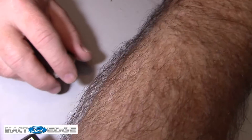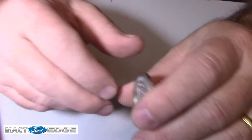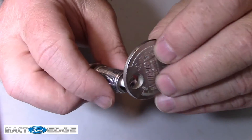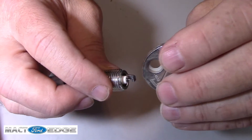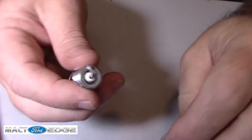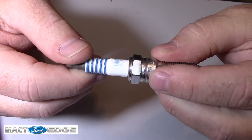Essentially what we've got is four spark plugs at .051 and a couple that are nearly .052. Again, you want to be careful with the gaps — you can adjust them. You can pry it up or knock it back down by pushing on the end, adjusting it using this tool. As far as the gaps go, that's where they're all at for six spark plugs. These are the Motorcrafts — they're platinum plugs. Iridium is a harder metal. The plugs are pretty much uniform .051 to .052 straight out of the box.